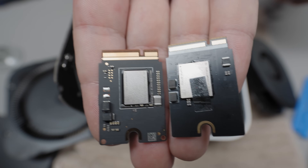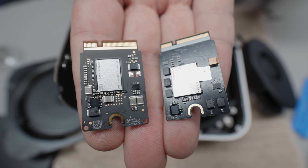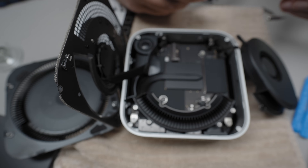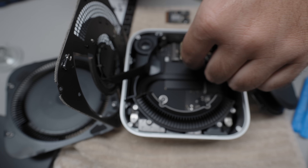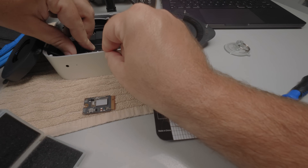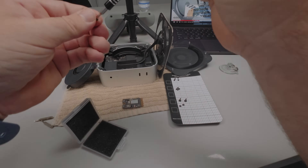Here is what the two SSD NAND chips look like side by side. As you can see, they look a little different but the overall configuration is the same — there's one NAND chip on the front and one on the back. The circuit boards look a little different, and there's obviously a sticker on the third-party one where there's none on the original. I'm now going to put the third-party SSD in and put the original 256GB away — but definitely keep it, because you may need it down the line if you ever uninstall this SSD or need to revert to the stock version.